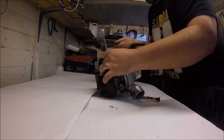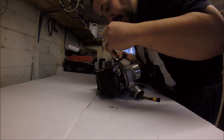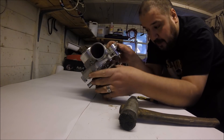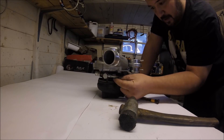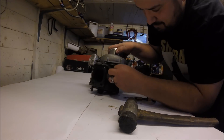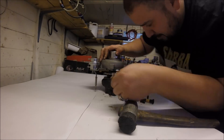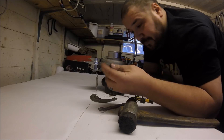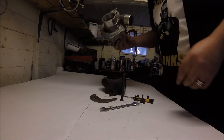If you round a bolt on the turbo, trying to get it out afterwards is one of the most almighty pains in the ass you've ever tried, because some are in awkward places. That's why I didn't loosen them all at once — most of them are totally inaccessible, but once you can spin the housing you take out the bolts one at a time when you can get to them. That's the last bolt — now we can remove the core and front section from the turbine housing. Simple.